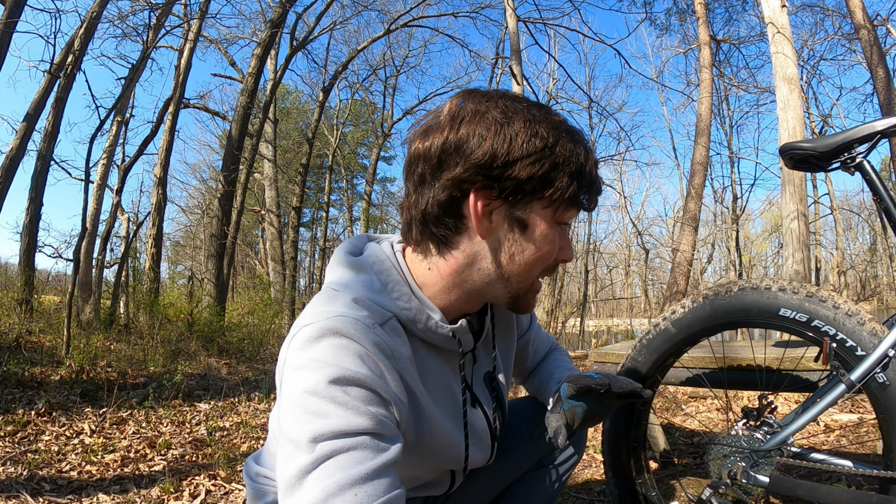And the seat post, which I mentioned a little bit earlier, is a 31.6, and the seat post clamp is a 34.9. So I mean, upgrading to a dropper post later, you don't have to do a 27.2 like a lot of the budget ones you have to. You can buy a nice dropper post if you want to. That's crazy. And of course, if you buy this, you're going to be on a budget, so you may not have the money for that. But I mean, the upgrade potential here is insane.